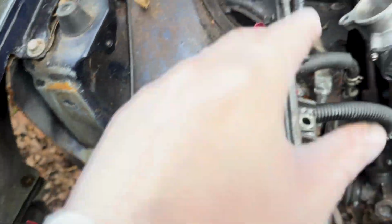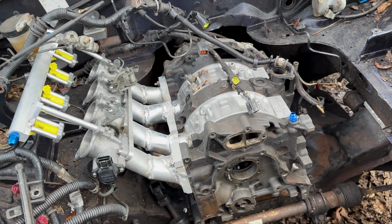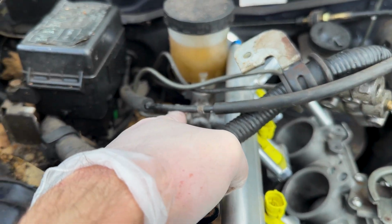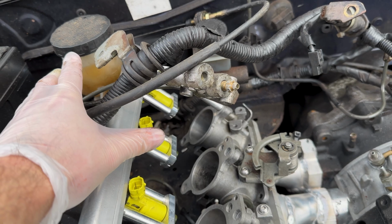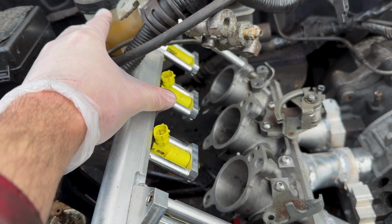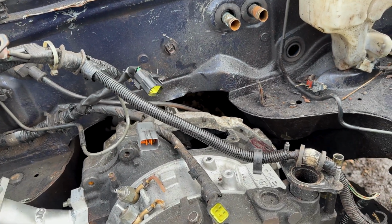And then the rest of it's all just headlight wiring, which I'm going to tuck down the side of the fenders to clean up. And then you start looking at braided brake lines and stuff. I'm going to grab myself a Mark II brake master so I can get rid of the bias and just run the front brakes. Obviously rear brake will still be on handbrake. I need to pick up a slave cylinder for there at some point soon.